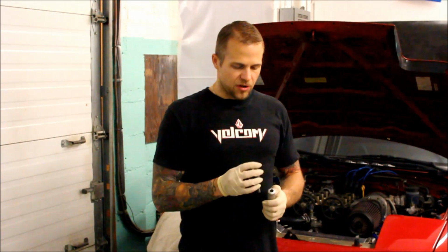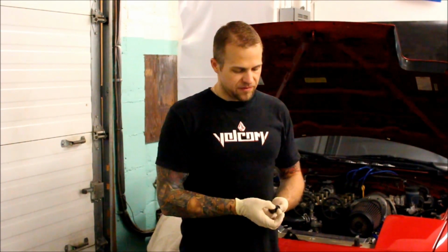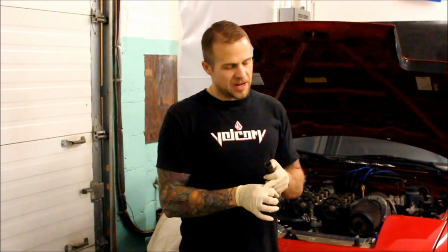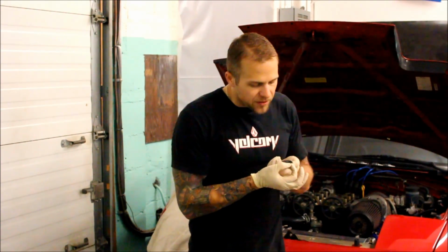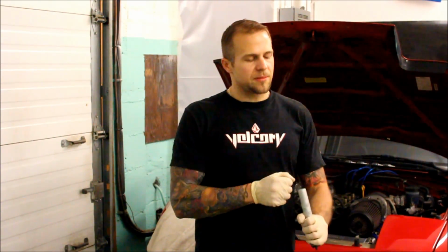When you go to reinstall, you put the tool together like this. You have the keepers lined up inside the retainer, ready to go. The bevel right here goes in between them. This is spring loaded. You have it on your assembly, you give it a good whack to come down, and the spring will push the retainers into place, and as the assembly comes back up, it locks.